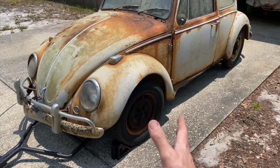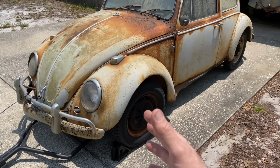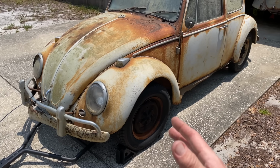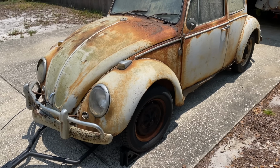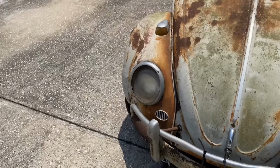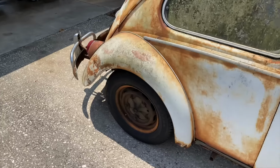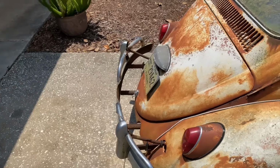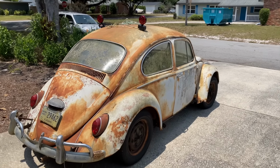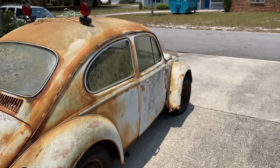When I was leaving, the wheels almost were out of control, wobbling back and forth, and I kind of backed up and forth a little bit and they straightened out. And I was very cautious for the first few miles and drove real slow. So something's going on with the steering box. It's okay if you're going straight and fast, but it doesn't like going slow and around the corners. So we gotta figure out what's going on there. I'm assuming the steering box is just shot. So we're gonna dig into this.